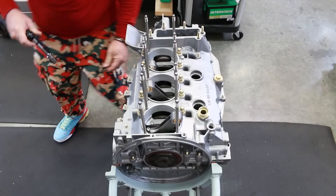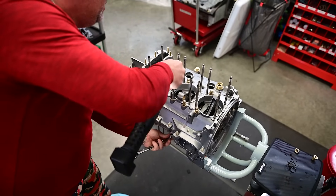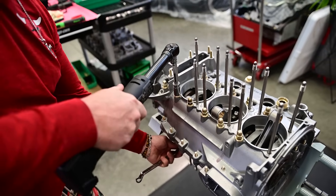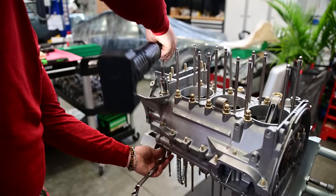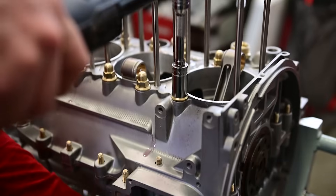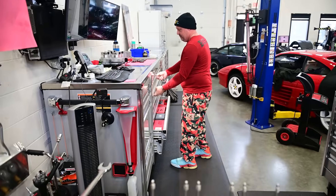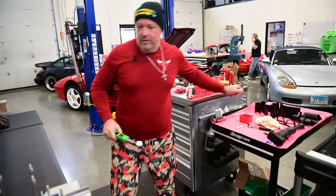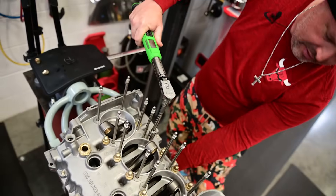I'm not running this down with a gun — I'm just speeding up my process a little bit, not running it to its full capacity. I'm using this FDX socket on my gun because it grabs the hardware a little harder, a little tighter tolerance, and it doesn't mar up the fastener — whereas a looser one will. We can turn our big fan back on. I'm ready for it. Now it's torque time — these go 35 Newton meters, starting from the center out.